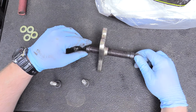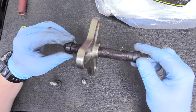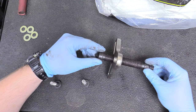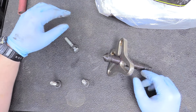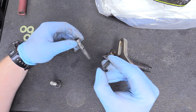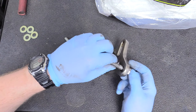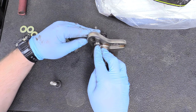You want to make sure that all the threads are greased as well because there's going to be a lot of pressure going through there. I have greased the threads very well because if you put grease on it, it's going to make it easier. The next thing we're going to go over are these bolts. The washers are really important — you want to make sure those are really robust thick washers so that when you put it through, it's not just going to pull the bolt head through the gap.